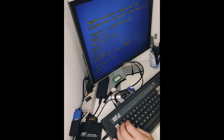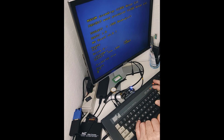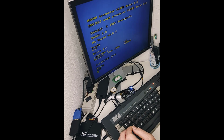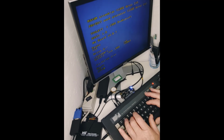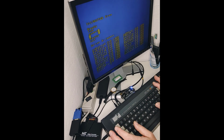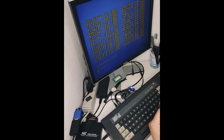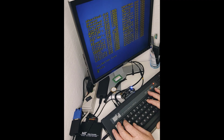So remember to change directory, it's pipe cd, and then press enter on the CPC 464. And then it will prompt you to enter something. So I'll just type games. And there we are, we're in the games. And these are all the games that we copied over effortlessly from the PC onto the M4. Just like that. So let's see, can we actually run one just to prove that it works.